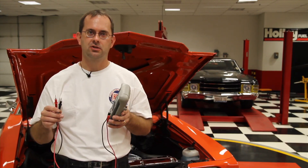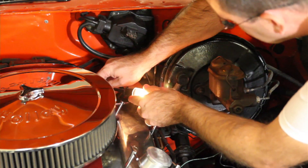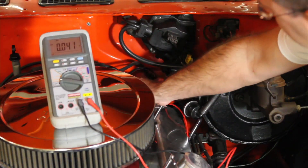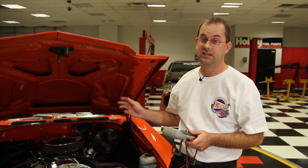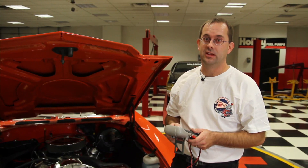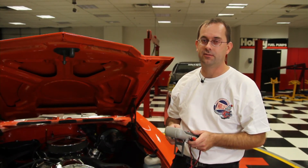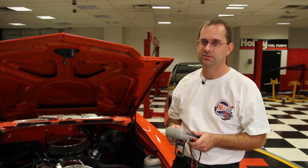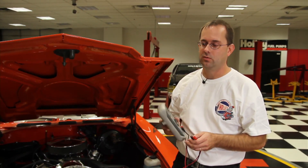When you put fuel injection in a car that has 40-year-old wiring, there's a good chance that there's worn, deteriorated wiring. By probing points with a voltmeter you'll find out if you have 12 volts or 9 volts. What's actually the case with this car is it has the ballast resistor left in it. If we raise the RPM on this car, you're going to see the voltage drop even further, causing potential problems. That's an example of why a test light is a bad idea and why you want to use a voltmeter.